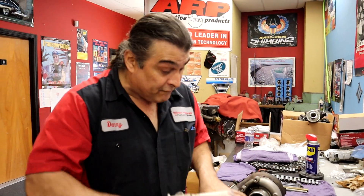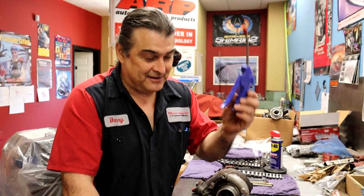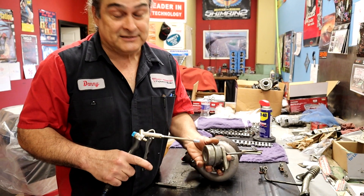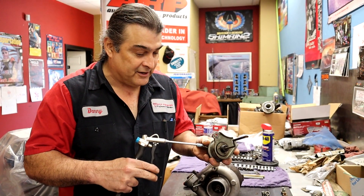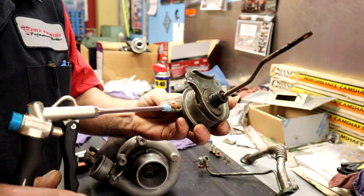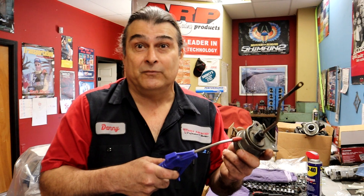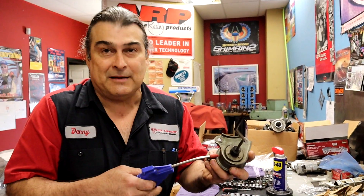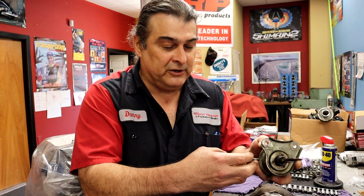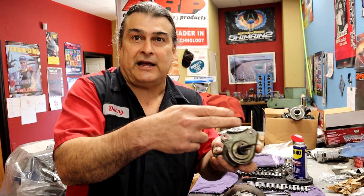For this particular thing, me joking about his fancy tool is because I'm jealous of it. This is actually better because now we can test this without blowing it away — we can sit here and look at it. I don't suggest people do this with a regular air gun because you would actually blow the diaphragm. In testing it, you'd destroy it — you'd be putting a hundred pounds of pressure in something that's only made for about 10. So what you really want to do is put a little gauge with a little regulator, put air into it, adjust it, and check when it's working.